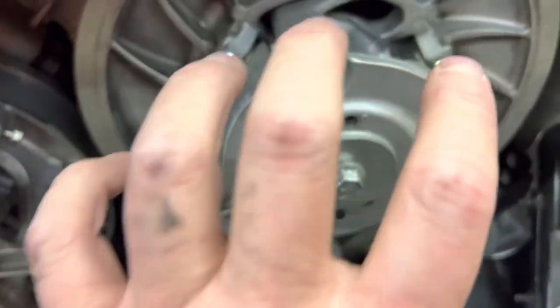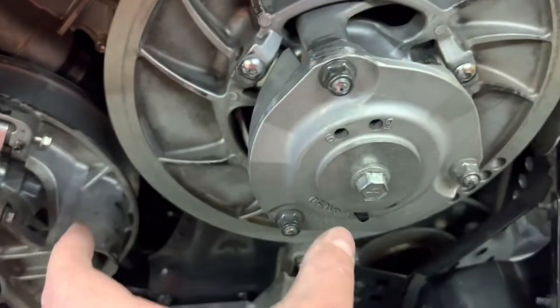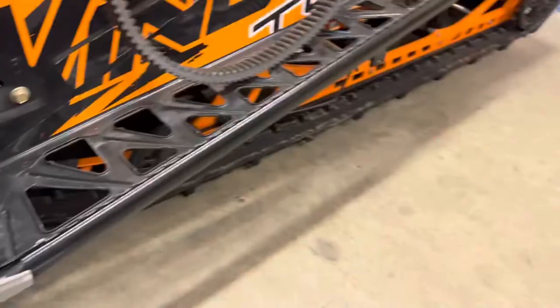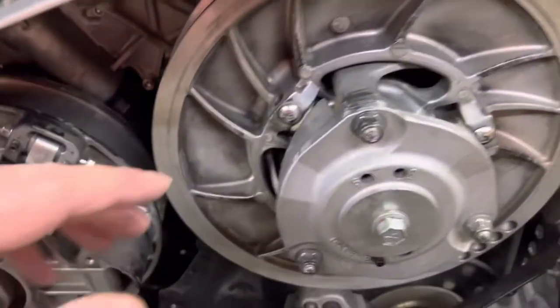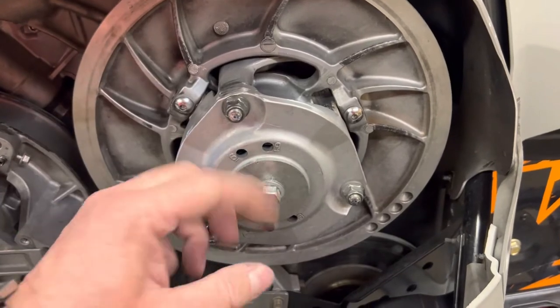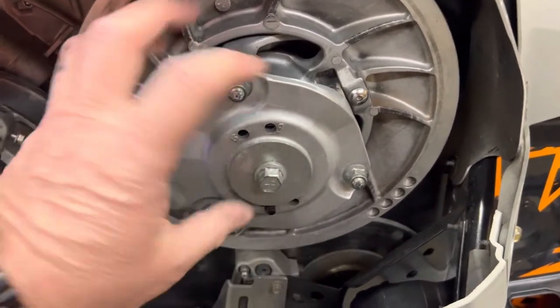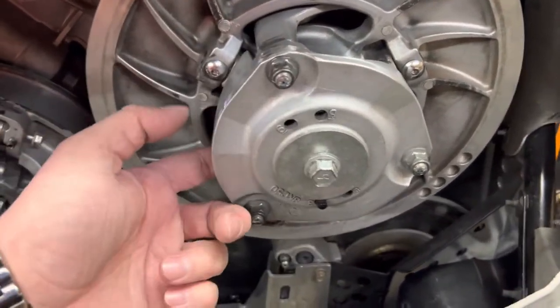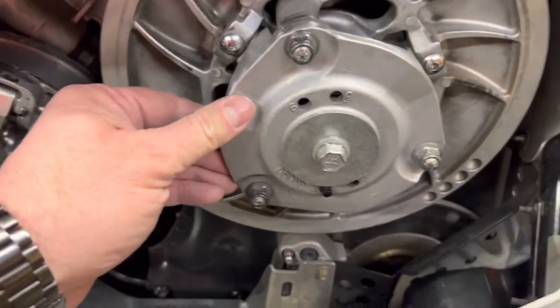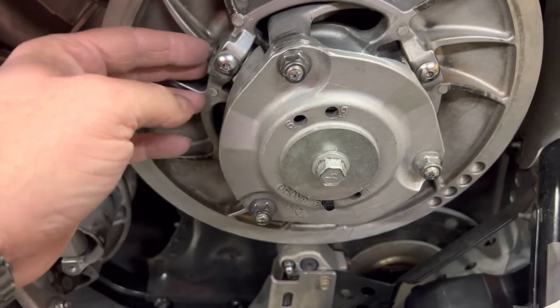You've got to be very careful because once it gets out so far, it wants to twist 60 degrees. In my case, BTXL 175 track, it goes to a 60-degree twist — 40 degrees I think for the trail sleds. But pull this out, pull these out, and then this comes off. The spring just flops right back in — good to go. Easy peasy there, just no special tips or tricks on that.